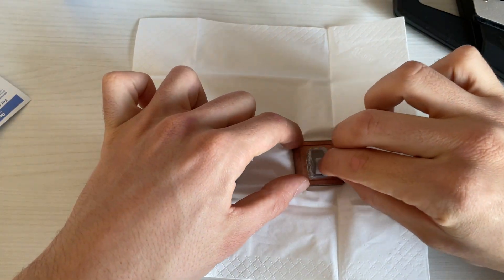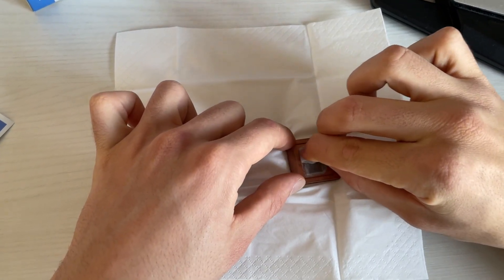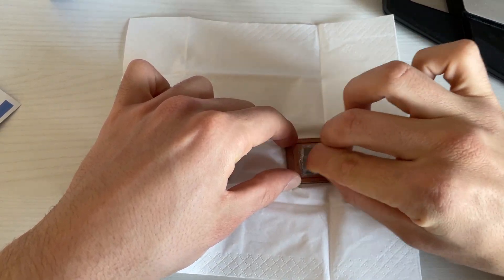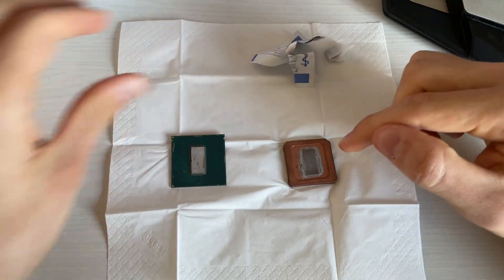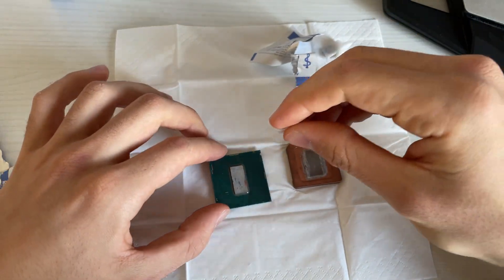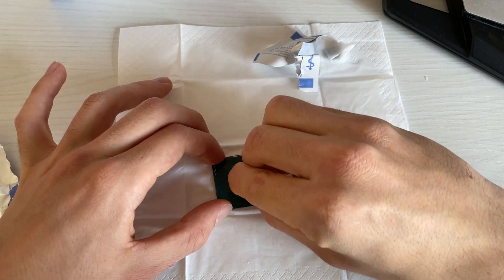It's basically impossible to remove completely. But the old liquid metal is not going to impair the thermal conductivity of the new one, so you really don't need to worry about it damaging your performance. This is as much as we'll be able to do. I have nail polish on the conductive side of the CPU to prevent the liquid metal from going there, and our application was quite nice so we didn't actually need that.